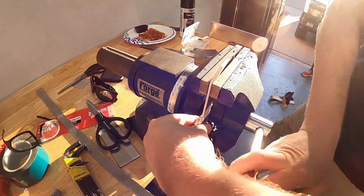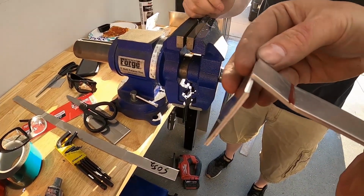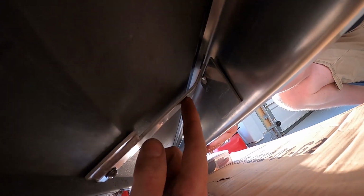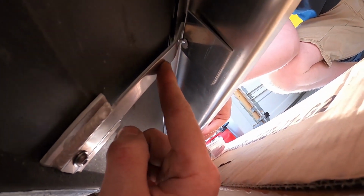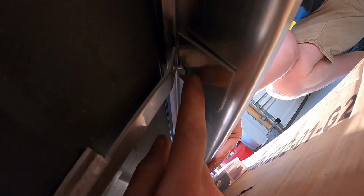And again, now, just weld this to it like this. All right, so it's bolted up there. Side skirt's mounted where it needs to be. You can see how this is laying nice and flat there. And when we go to drill it, we're just gonna pick it up just a little bit, just to get some more clearance on the bottom there. You can't see it now, but I'd rather not have any chances. So now we're just gonna finish welding that up. Then we'll drill it for a riv nut in here, and we'll end up doing the actual skirt.